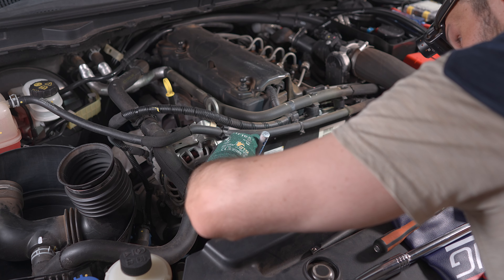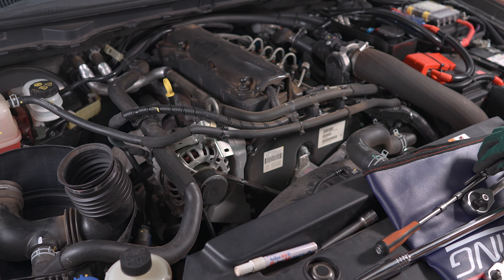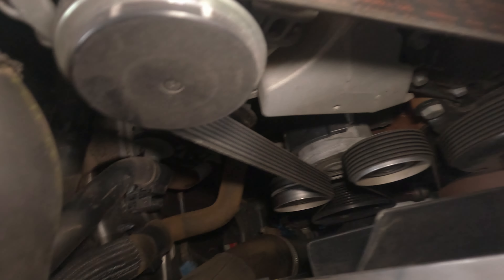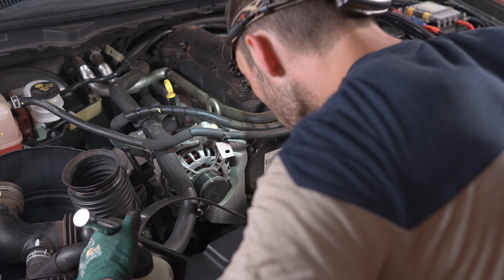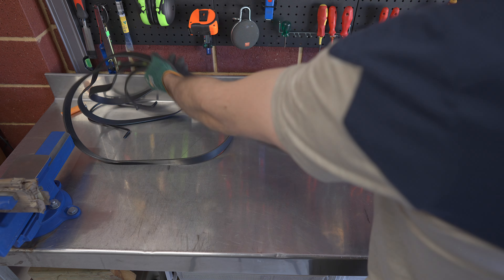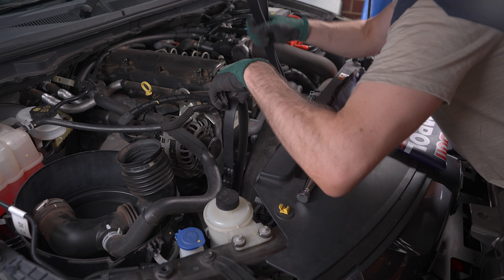Now because I'm going to keep this belt as a spare, I'm marking which way is the front of the car — or you can mark the rotation — because if you're reusing a belt you want it to go on the same way it did before. A 6mm drill bit goes in this hole just to the right to hold the tension. With the GoPro we can get a better look at the belt path and over here is the air conditioner and water pump. Breaker bar clockwise to release tension, then put your drill bit or podgy bar in. I marked up the old belt to compare it to the new belt — same width and length — so it's good to go.